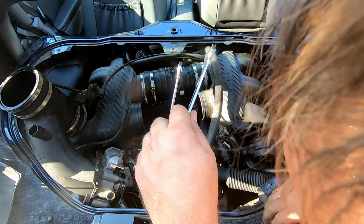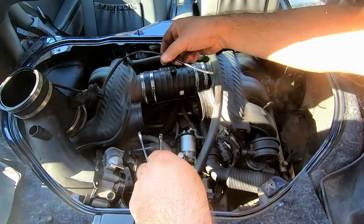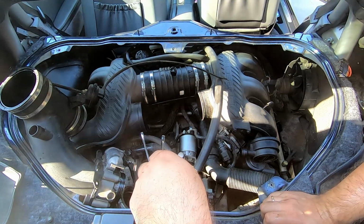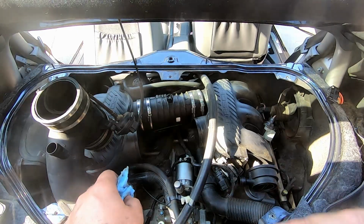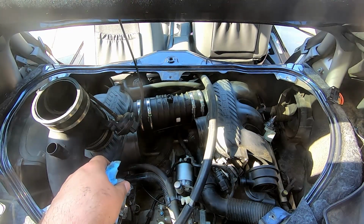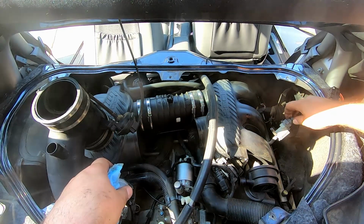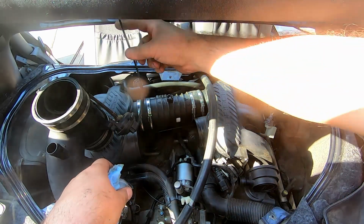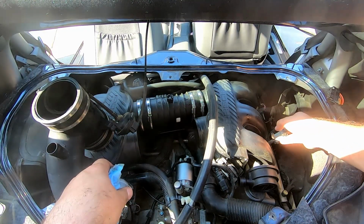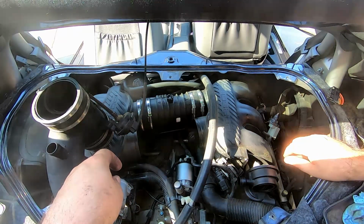Torqued. Okay, now give me a couple minutes to find where this vacuum tube is going to, and we'll try to put it back in place. So looks like I found where this vacuum hose came off from. This is the solenoid on the passenger side, and looks like it was just rotten here because there is the empty space, and I bet that's our culprit.